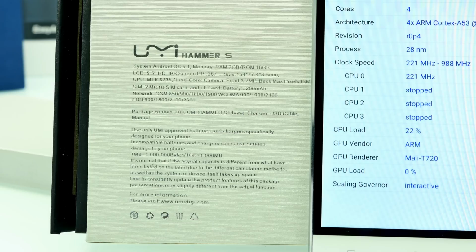It's a quad-core processor, but only clocked at 988 MHz, so 1 GHz, and the performance is kinda low. The front-facing camera is 2 megapixel, the rear camera 13 megapixel, but either interpolated or using some Sony IMX 179 or some kinda old sensor, so you can find it down below in the description. It's dual SIM, supports microSD cards, has a 3200 mAh battery with real capacity, and the FDD-LTE band B20 is also in there. Also, it's a very stable phone, so the body quality is very nice.